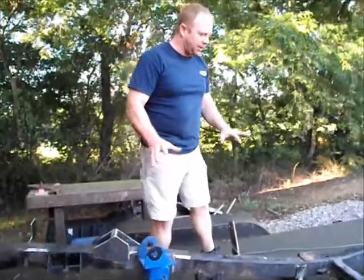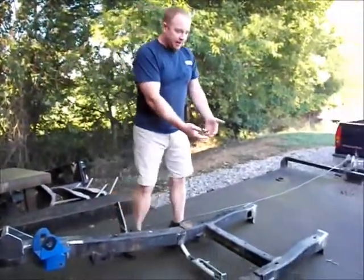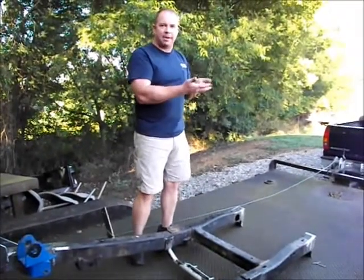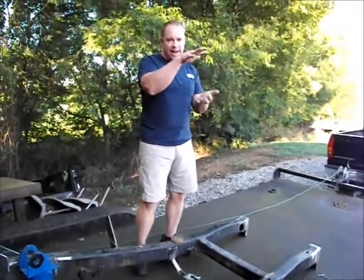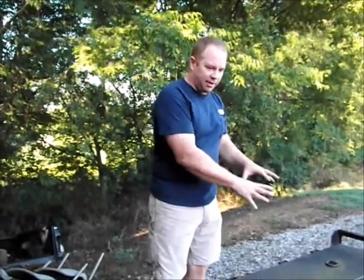And then as we're going along here, we just noticed the gas tank goes back here in the rear. They had the gas tank bolted to the bottom of the frame, sandwiched to the bottom of the body. So the body moves around and the gas tank is just rubbing on top of each other. So I've already got an appointment for this to go to the blast shop. When we get it back from the blast shop, then we'll put the gas tank in it, and we'll build our framework so that it'll hold the gas tank securely to the frame only.